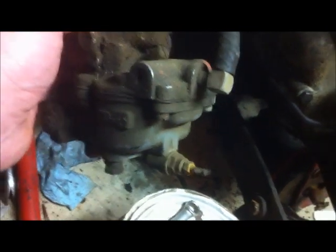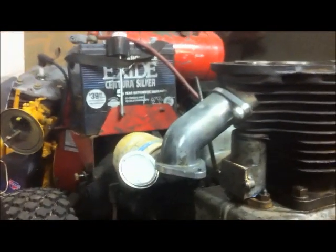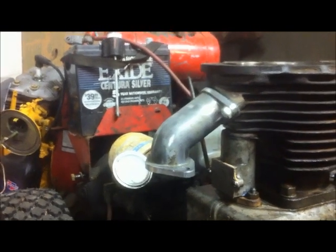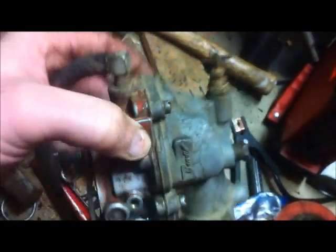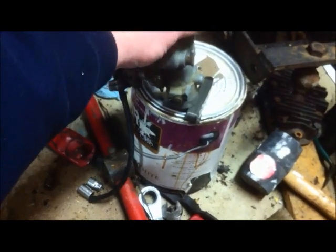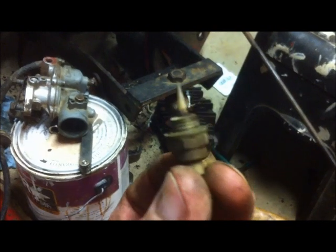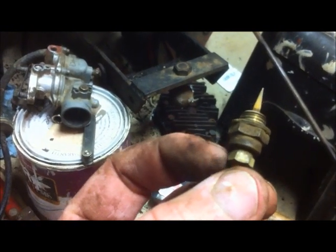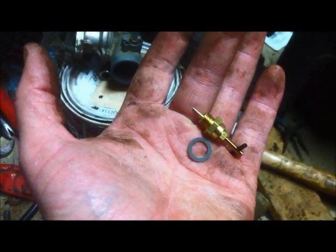The main jet on the back there actually leaks like crazy, so I have a new main jet I'm going to put in. I polished up the intake manifold with a wire wheel — it came out pretty nice looking. So I cleaned up this carb and got it all nice and free of grime. I'm going to take out this main jet here. It doesn't look that bad — it's just got a little bit of surface rust on it, but it leaks where all these threads are. We're going to replace it with a brand new one, which shouldn't have any leakage. I'm going to screw that back in and tighten it up.